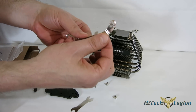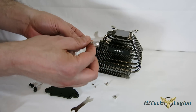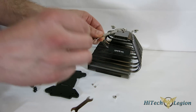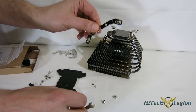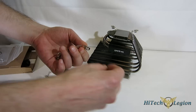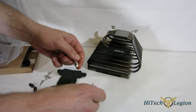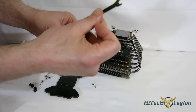You want these on before you ever put it on the cooler, before it goes into the case. I've seen many people — reviewers also — who couldn't follow the manual, because like I say it's not well written, who were trying to put these on after, trying to tighten it down on top and trying to get under it with this little wrench, and that's not the way it's done at all. So this is a huge step right here — get both your retention brackets prepped prior to putting them on the cooler itself. Once we've got that done and they're snugged up, we never see this little wrench again.